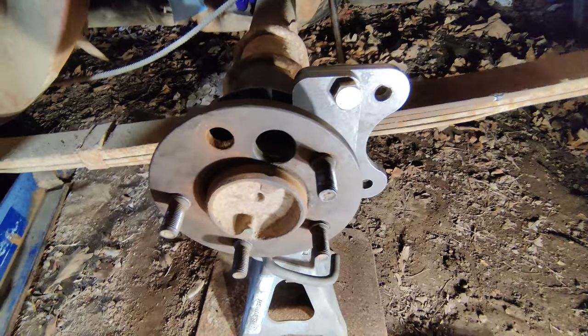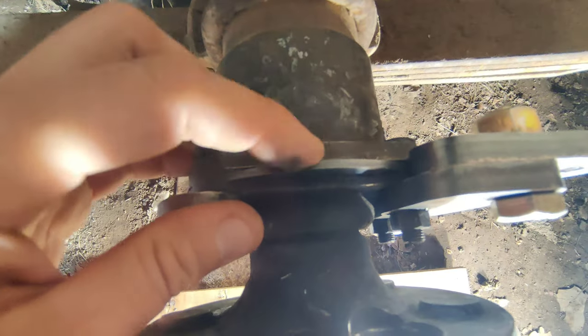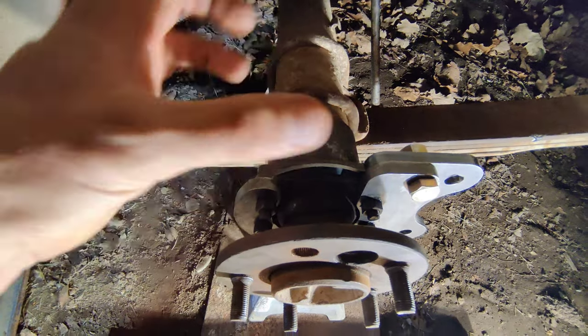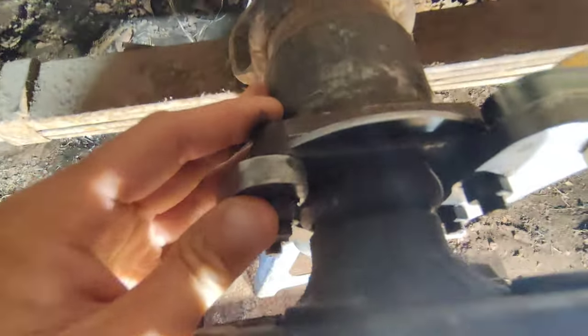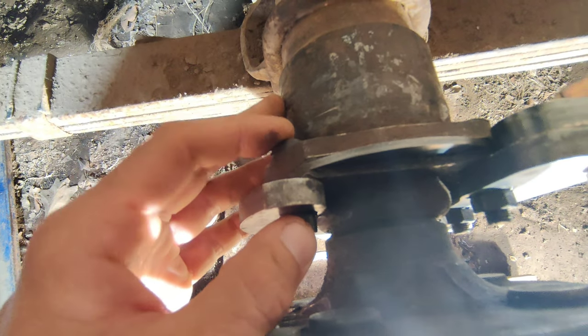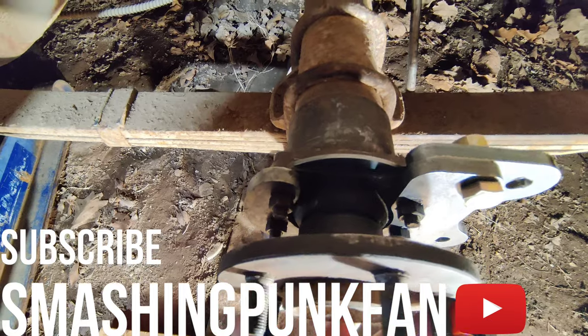So what this guy created is absolutely genius. He created a bracket system that works, bolts right up. He also includes a backer plate to replace the distance from where the drum assembly was before. So the only thing you'll have to do is get longer Spicer bolts. I will include a link to them in the description and the size you need. I got mine off of eBay, 15 bucks, got all 5 bolts.